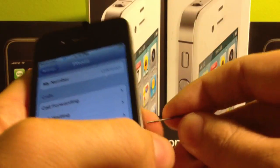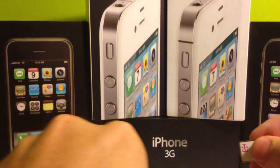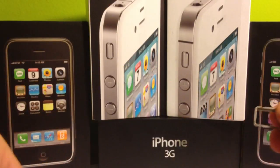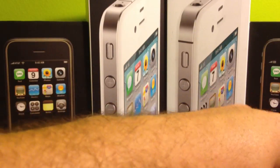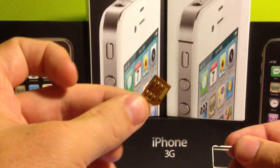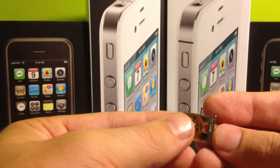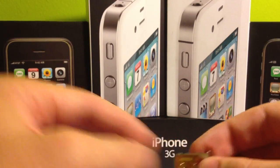The SIM card's good, but if we put it in with the RSIM, it doesn't even recognize it at all. So there we've just troubleshot it and we know that in this case with this RSIM, it's defective and it doesn't work. So if you're having the same issues and you just can't get it to register at all, then you need to get a new RSIM.